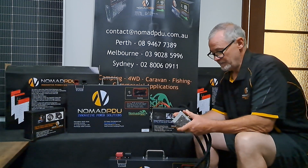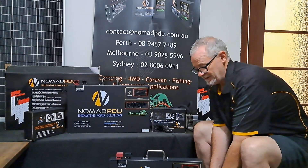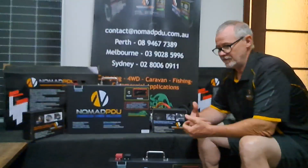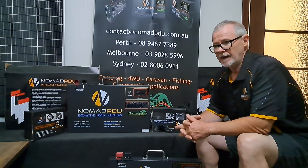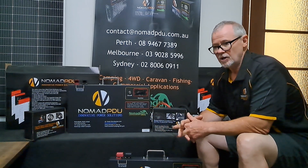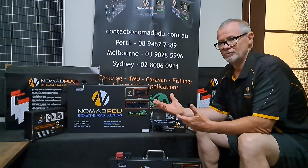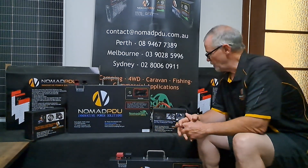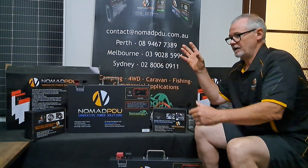In general with DC-DC, you'll find the bigger name brand units that charge up to 50 amps, sometimes more. A 50 amp charge is significant. You'll find a lot of really good chargers from 25 amps up to higher than 50 amps. The DC-DC quite simply takes the current from the vehicle, goes to the DC unit, and then to the battery.